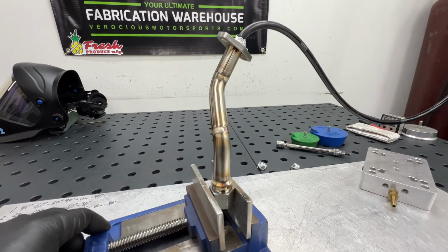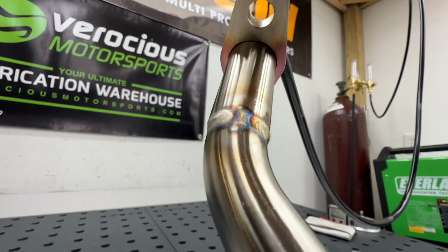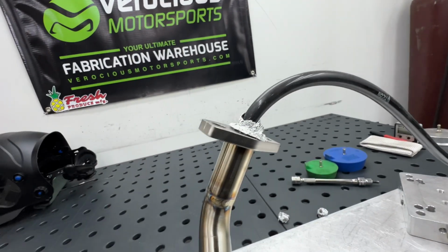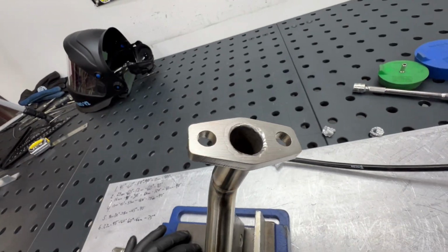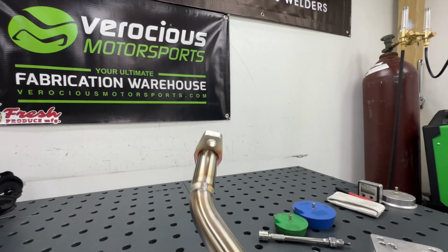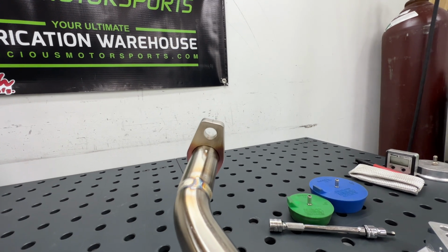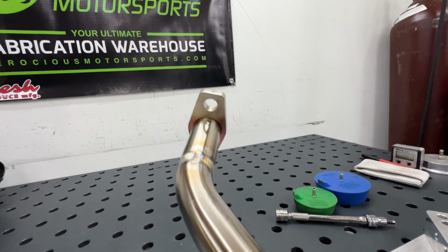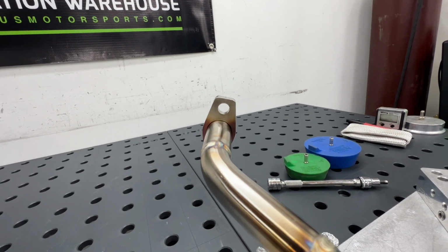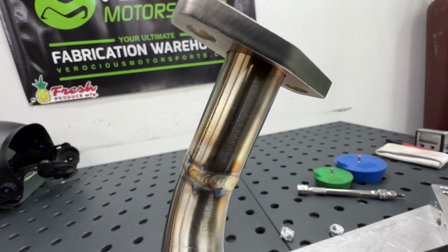Get the oil drain finished welded. I want to talk about a couple things. I didn't weld the flange on the outside. I did weld it on the inside and resurfaced it. Mainly, I didn't want there to be any chance of the bolt getting into the weld. Although there does appear to be a decent amount of room, just didn't want to deal with potential clearance issues.